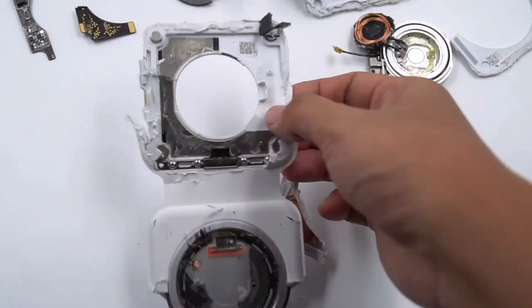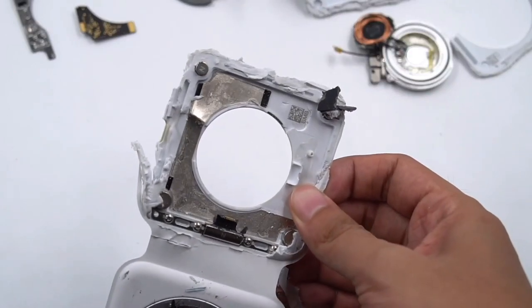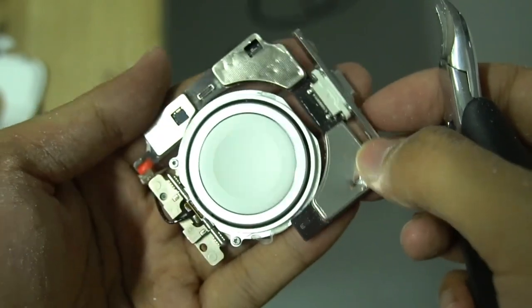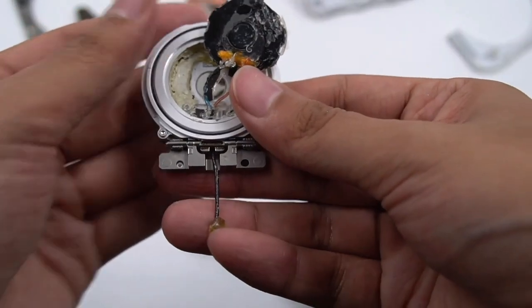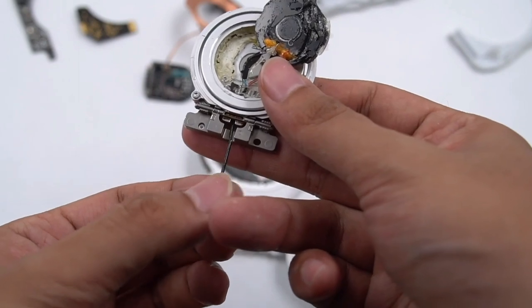After removing the small input board and the Apple Watch charging module, we can see the aluminum foam on the PCB's back. The front of the PCB is covered with three shields. The Apple Watch charging pad is fixed with screws. The coil is connected to the PCB through a wire, covered with a black insulation tube.